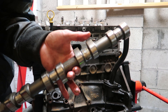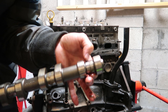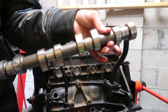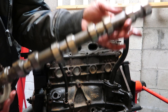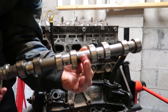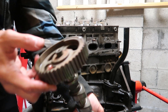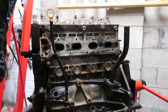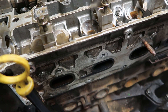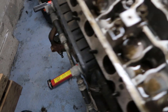Aside from the surface rust the camshaft actually looks really quite nice — there's a little bit of wear on this bearing here, but I've seen a lot worse on these. I'll spray it down with some WD-40. These camshafts — pretty sure they're the same part number; the inlet and exhaust are interchangeable, you just locate them differently on the gears. You can now see on the buckets where the oil has mixed with the water and you get that milky brown sludgy stuff.